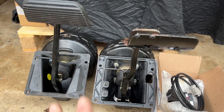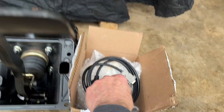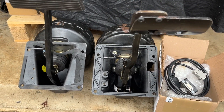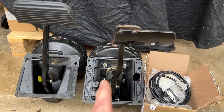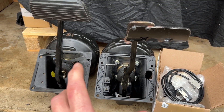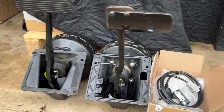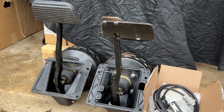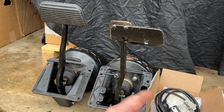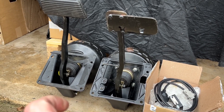The idea is that I'll have to put everything back together to get Glen his data through this data logger, but the pedal box will actually be in situ and fully working. Then when I eventually go fully manual, I just have to remove this plate, untie-wrap the clutch, fit the master cylinder, and away I go — I don't have to take the whole thing out again.